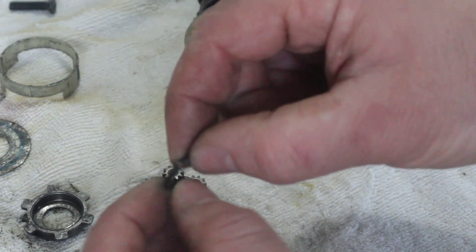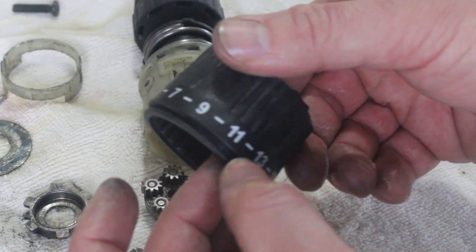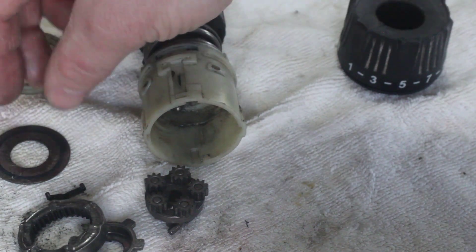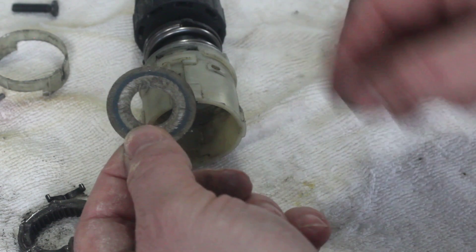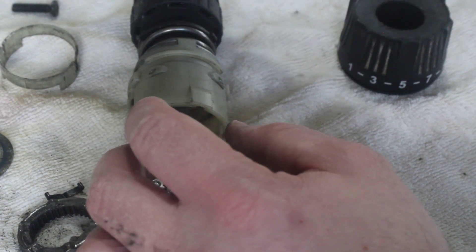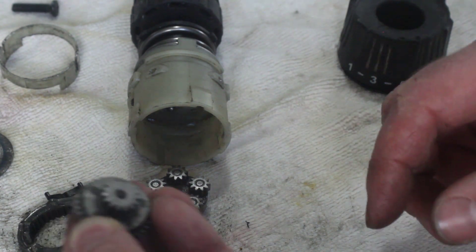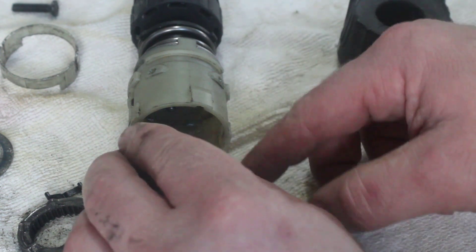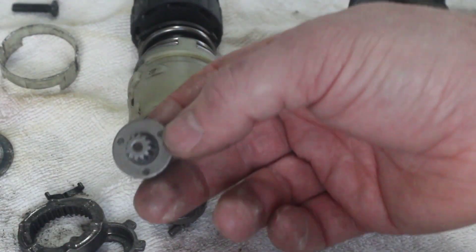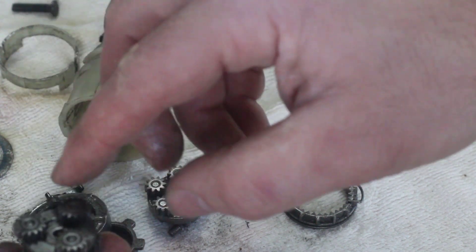This is our five gears and that engages the part that goes into the clutch for the torque settings. One last piece is this little bit — all that does is engage with these little notches around the edge so that it positively locks into position on each of the clutch settings. This is stage one — technically the last stage of the gearbox because we're doing it in reverse. There's a backing plate held in place by two pins which go through the sides, just to hold the stages separate from each other. The next piece is another planetary gear set, where the sun gear of this goes into the planets of the first one. And then on the other side is yet another planetary gear set, where the sun from the new one goes into the planets of the one we just mentioned.